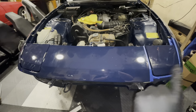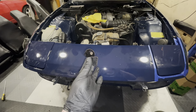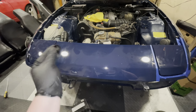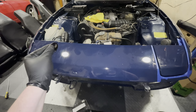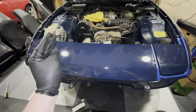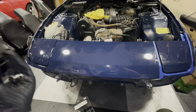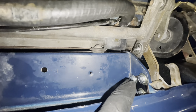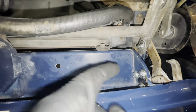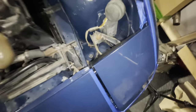We've got two headlights installed and adjusted — I'm quite happy with where we are. I need to do some more work on this one because I figured out what these plates are: they are not spacers, they are braces. You have to put them on the opposite side of the hinges to protect the body, so that you don't have too much torque going through the thin metal when driving at high speed with the headlamps open. On the inside you can see that's where the plate sits and that's where the hinge sits — the same goes for the other side.